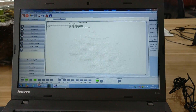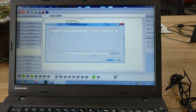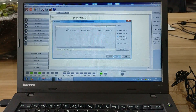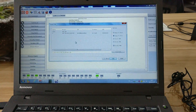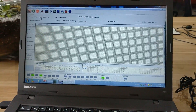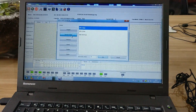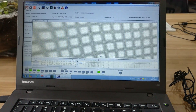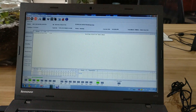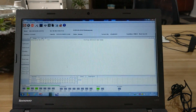At this time, we need to set up one imaging project. New project, next step. Disk image, next step. Here we can select image to file. If users connect one target drive, you can image to disk as well. We click OK — the drive has been well detected. We click head map to set up the head map. It's a Western Digital hard drive, Royal Family. We click OK. The selective head image has started and the program is setting up the head map. We can see the head map is set up very quickly.